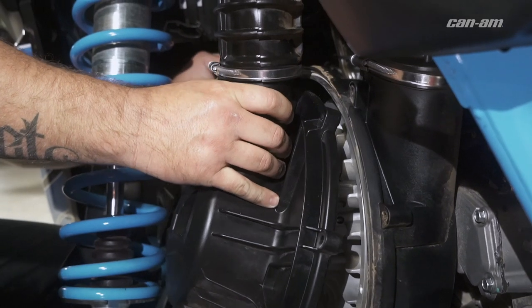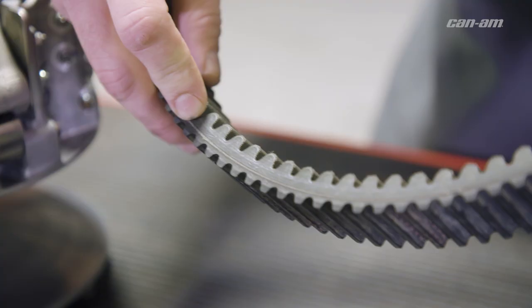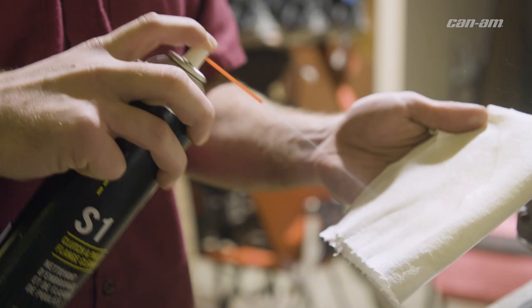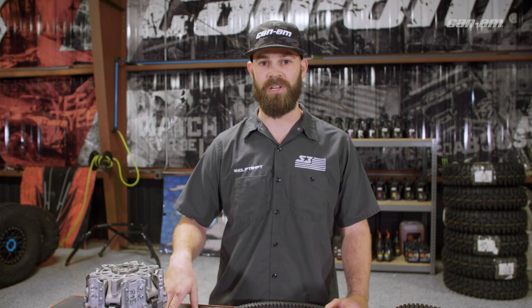Let me tell you the difference between flexing and wrecking. The first thing you need to do is open up your belt box. You want to get in there and see what's going on. I like to open my belt box every two to three rides. Check the belt for any glazing on the outside, and see if you have any cogs missing. Blow the clutches out, spin them around, wipe the faces of the clutches, and make sure there's not any imperfections or damages to the faces of the clutches.